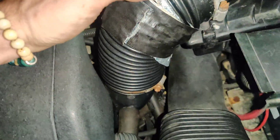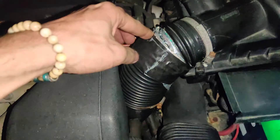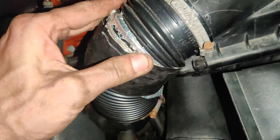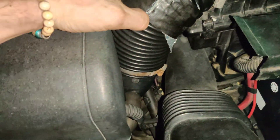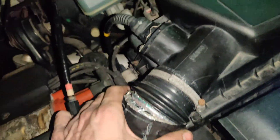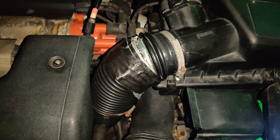This could contribute to why it doesn't read - looks like it's all busted. I don't think there's anything in here, it's just tape holding it all together because this is really rigid plastic. I would honestly go to the hardware store or something and just get some plastic that would fit. Because right there's your mass airflow sensor - crazy.